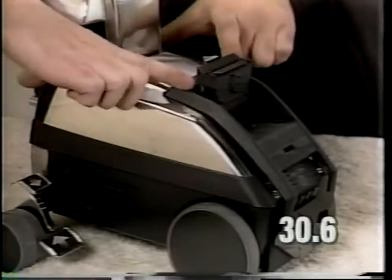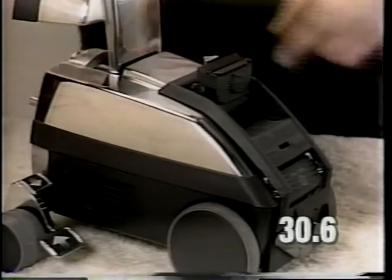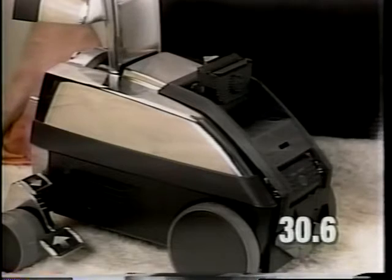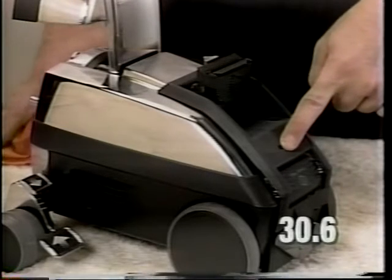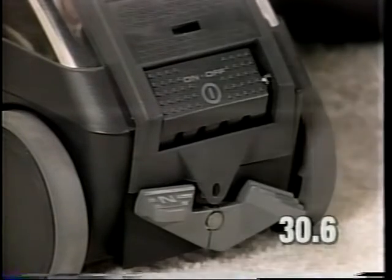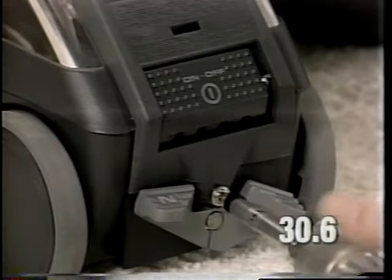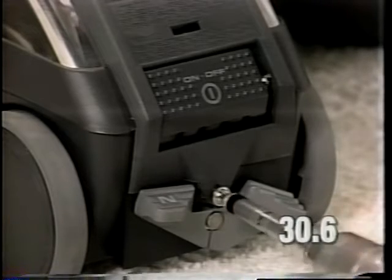Gently push forward and down to engage the front tabs of the scuff plate. To lock the rear of the scuff plate on, press down right at the slot. Install the scuff plate screw just above the neutral drive pedal assembly. Torque this screw to 5 to 7 inch-pounds.